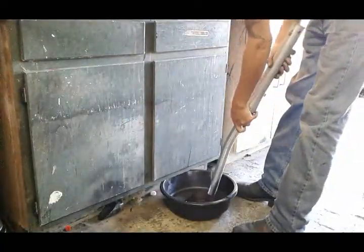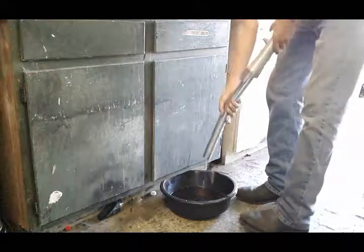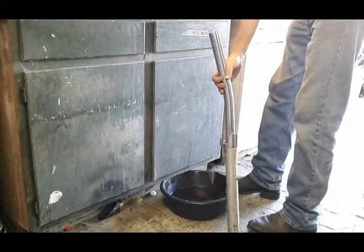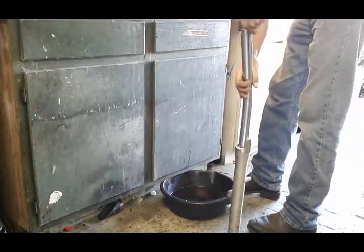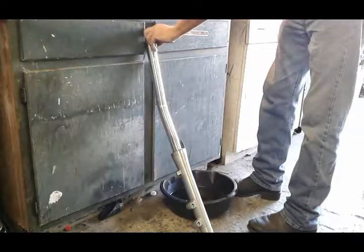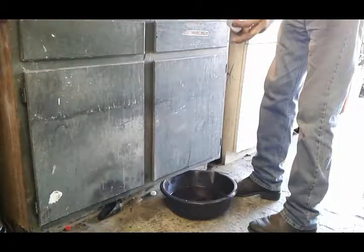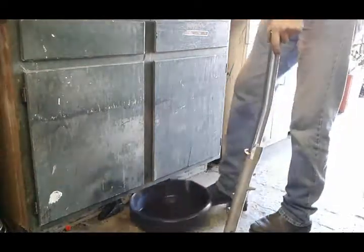Drain the oil. So I'm going to get this oil out of here, most of it anyway. This is a messy job. No matter how much you try to avoid getting oil on you or the floor or somewhere, you will get it on you. Okay, I'm going to put this back together just by hand. On this one it's a little different situation because it's bent. If you have one that is straight, the reason why I like to keep the top assembled is because it helps keep the bottom part from spinning on you when you try to take the bottom bolt off. This fork, we'll see what happens, but that's how I do it. I've been used to doing it like that for years.